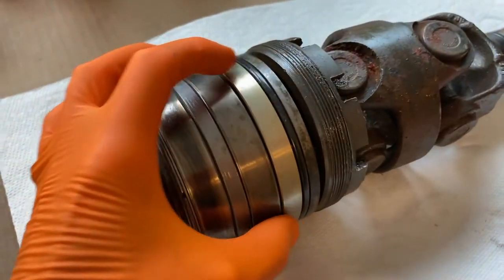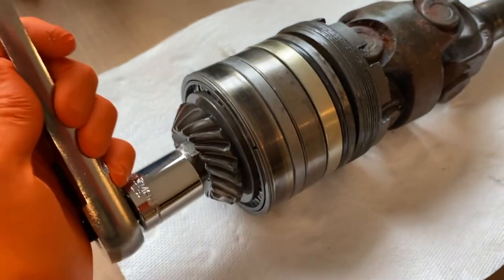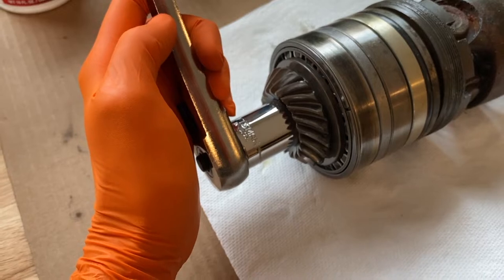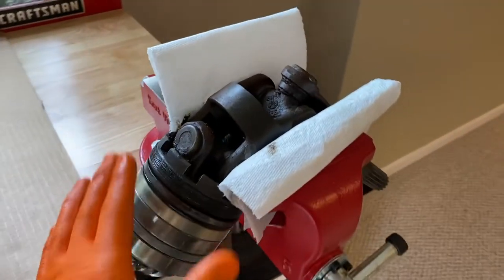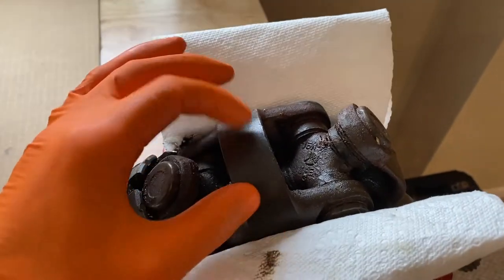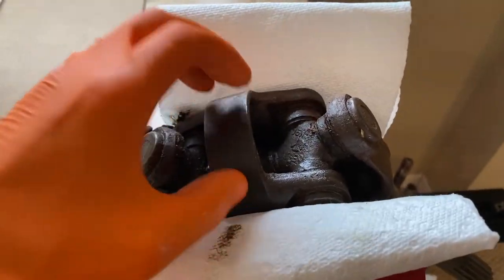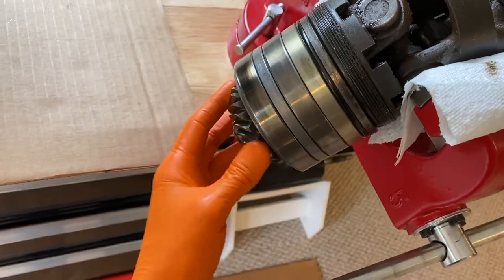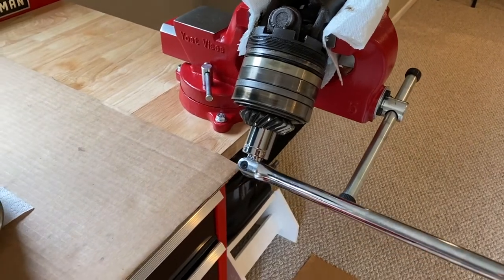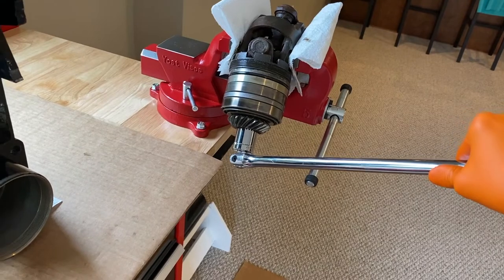We need to remove this and begin pulling the parts off the actual shaft to get the retainer nut. You may be able to hold the assembly with one hand and remove the preload nut with the other; however, if you can't, you might need to vice it up or use an impact drill with the socket. I've got the entire assembly in the vice, and I use paper towel just to add a little additional grip. Metal on metal tends to slide. This preload nut and washer have to come off, and we have to lock this assembly because as you turn this gear, the entire U-joint assembly turns with it. I used a breaker bar here and carefully, with the added leverage, loosened up the nut.